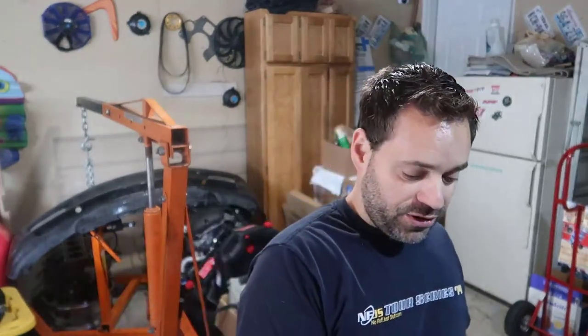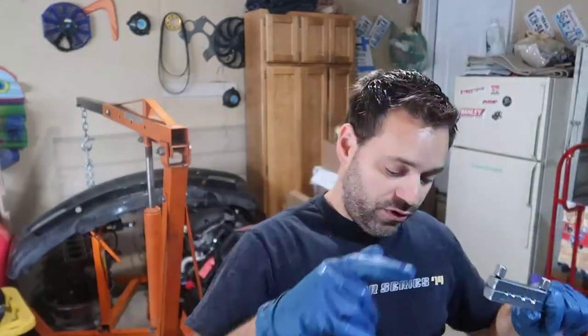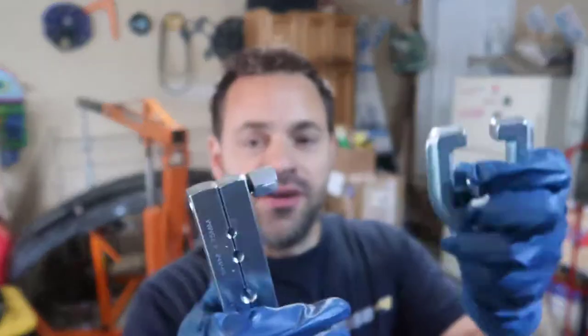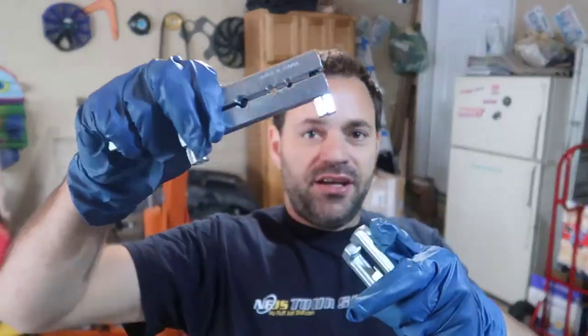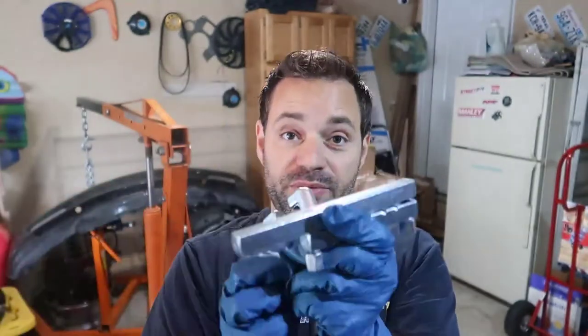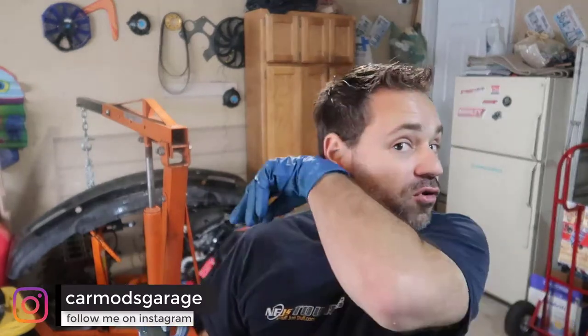All right, so that's the third time I'm trying to do this. What happens is, this is the bubble one. There's another one for double flare and single flare. So, trying to find a part here. There's the yoke and this little adapter, right? One first mistake I made in here: the brake line fits on the second one, which is 6 millimeters, but this adapter is 4.7 millimeters. The 6 millimeter doesn't fit. I made the flaring there, and of course, when I put it in the car, you spill oil everywhere.